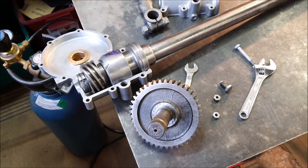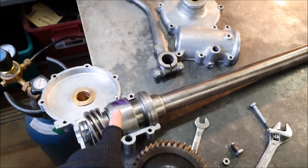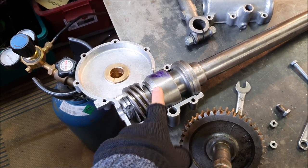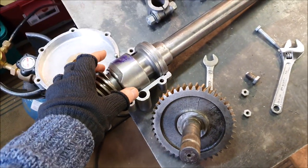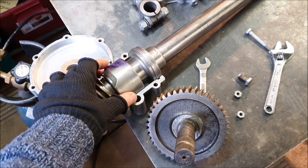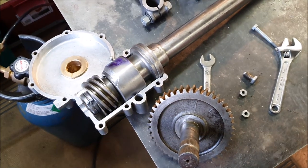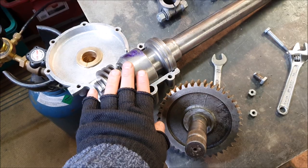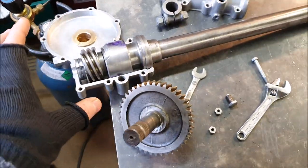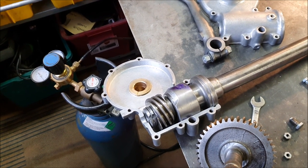I posted a question about this steering box to the Riley Register forum. The answer I got back is that this eccentric collar is for adjusting the mesh between the worm gear and the main gear. What you're supposed to do is adjust all of this to get the meshing correct, and then drill through the hole where the locating set screw goes to lock it in place. I've set that up temporarily by bolting the casing back together and playing with it with the steering wheel and drop arm attached, so I can look at how much play there is — and adjusting the column definitely makes a difference.